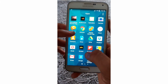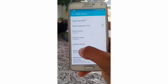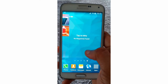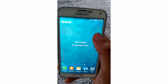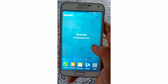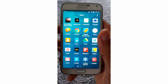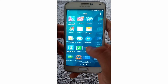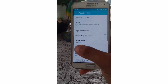The Samsung Galaxy S5 comes with the Qualcomm Snapdragon 801 chipset, a quad-core 2.5GHz CPU, and an Adreno 330 GPU. Storage comes in two variants: 16GB with 2GB RAM or 32GB with 2GB RAM. The chipset holds up quite well, though loading apps takes a little time. It can't run Fortnite, but PUBG and some light games might actually run on it.